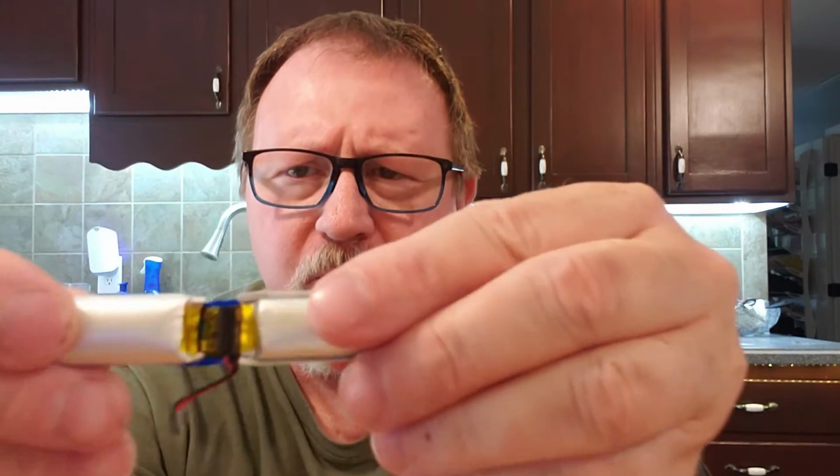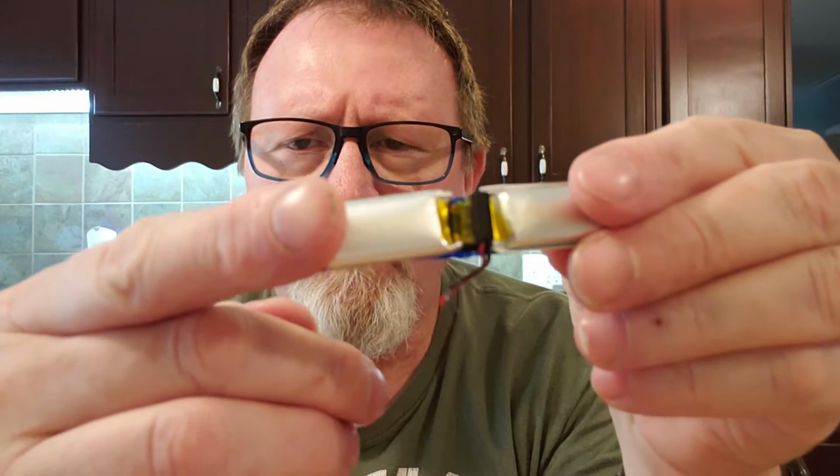The one that was originally in here said it was a 420 milliamp battery. And I think that's because there were two of these with a custom little piece of electronics in them that lets you link them together and act as one. I don't know if buying two smaller batteries and strapping them together would work or not. What I found was a 55-1430 180 milliamp battery, so a slightly smaller capacity, but still same voltage. It just means that it doesn't hold a charge as long, for $9. So I went ahead and ordered one.